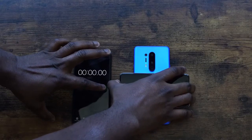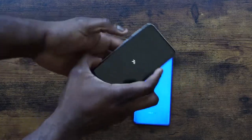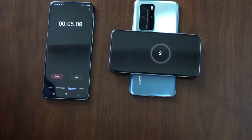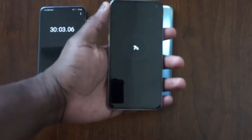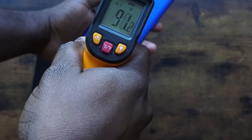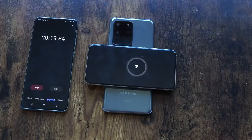Within 30 minutes from zero, the OnePlus 8 Pro gave 7% charge to the S10e. The Huawei P40 Pro also delivered 7% in 30 minutes. The S20 Ultra showed its prowess by delivering 15% in 30 minutes. I also noticed the OnePlus 8 Pro ran rather warm during reverse wireless charging — up to about 91 degrees — while the S20 Ultra was at 86 and the Huawei stayed relatively cool. The S20 Ultra is clearly faster and gives you more charge in reverse wireless mode.